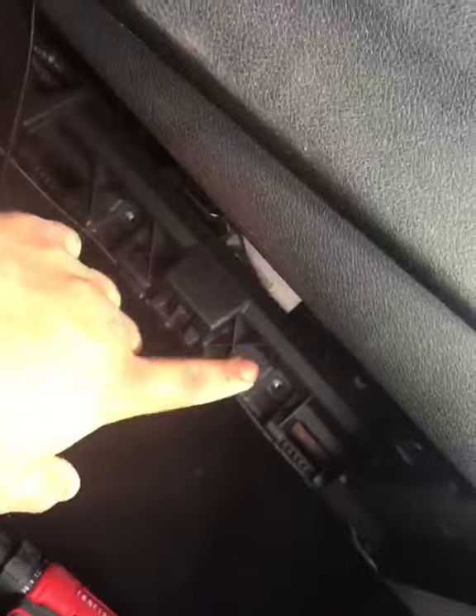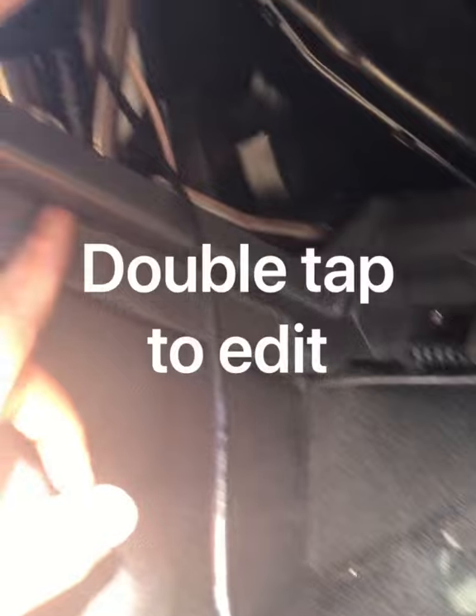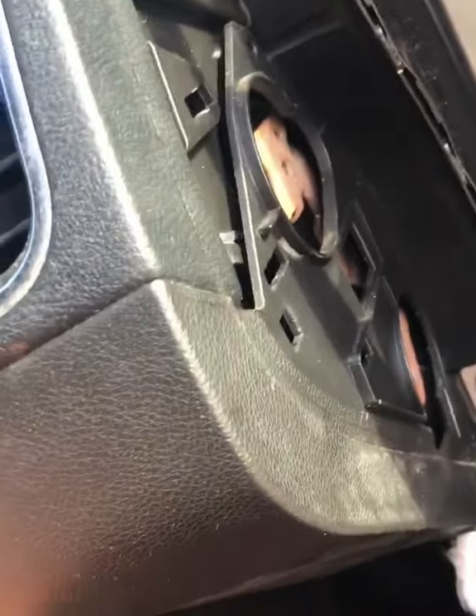Now there are only two screws in it. However, to change it, all you actually have to do is unclip. What you do is push in on this side of the glove box and push in on this side. Then you have a little cord — this string — that holds onto it as well. All you do is slide it down from the side and the glove box will hang. Then you have a clip here and a clip here if you want to pull it out. To make it easier — it's still a tight space in there — you can see it from this side as well, but I want to open that space up. You have one screw here, here, here, and then one here and one here.